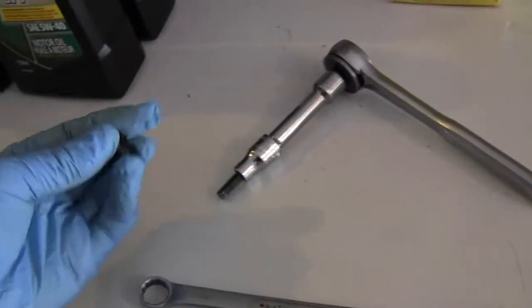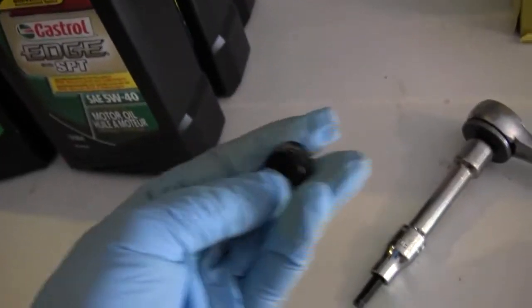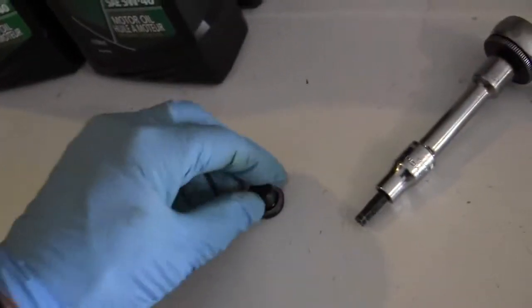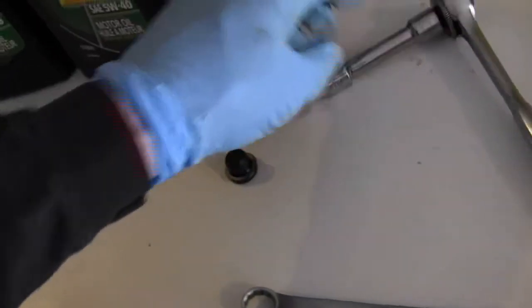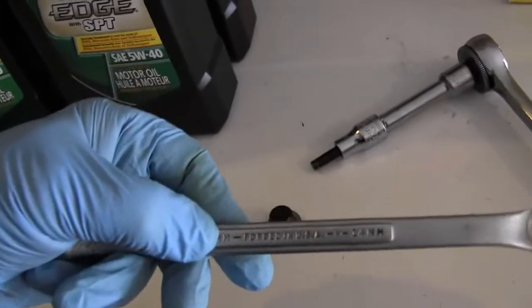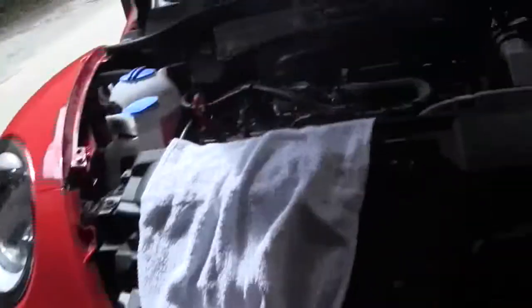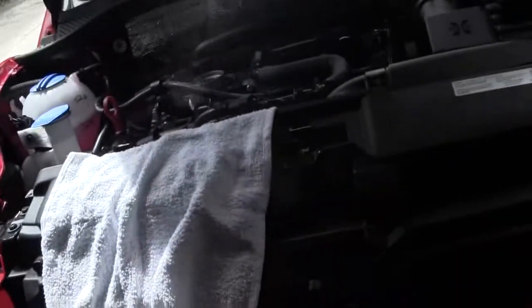Here is the original nut that came out, and it takes an Allen wrench to take it off. We don't use those anymore — that's just their idea of a joke. So what we're going to use is a 14mm wrench on my new plug that's magnetic to get the metal pieces out of there. I've got it up on my Rhino lifts here.